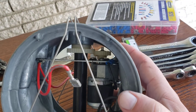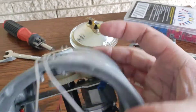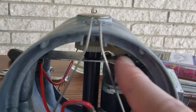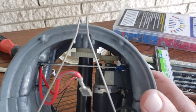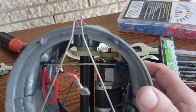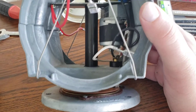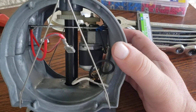Another FYI if anybody ever gets one of these: those nylon gears at the top — put some grease on those gears. These gears weren't greased. I'd put a little bit of synthetic or silicone-base grease — anything like that, doesn't need to be high-temp. It'll probably save you a headache.